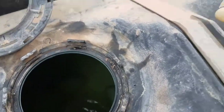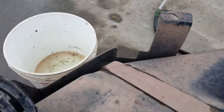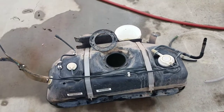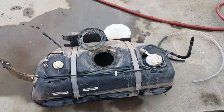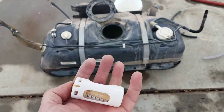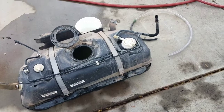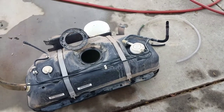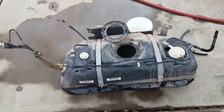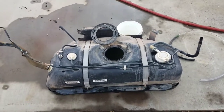I had junk down inside my tank — I used a hose and sucked it up and blew it into a pail. If you have this problem, good luck, but you can save yourself a lot of money. The dealer will not fix this slow-to-fill issue — they want to replace the tank, which is over five hundred dollars. The fuel pump is three hundred dollars and they'll probably charge you six hundred dollars to put it in. So if you have a little bit of mechanical skills, you won't have any issue.